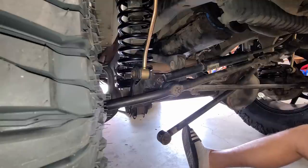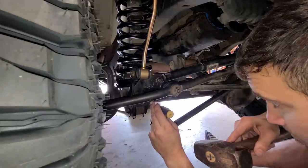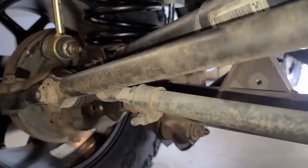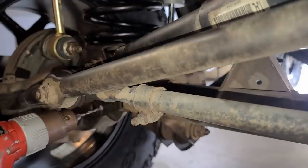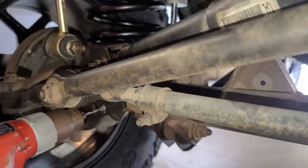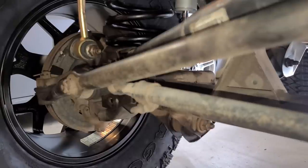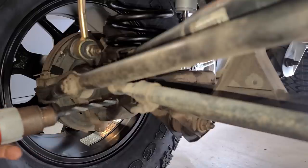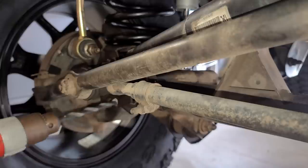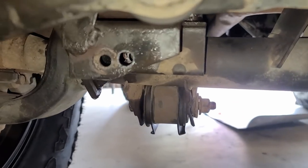Time to drill it out with a 7/16 drill bit and use the OEM hardware to get it all back on. Let's start drilling. Gonna start the drilling process with a smaller bit. Now time to go to the 7/16. Make sure you are wearing eye protection even if it fogs up. So I drilled the hole, front and rear.